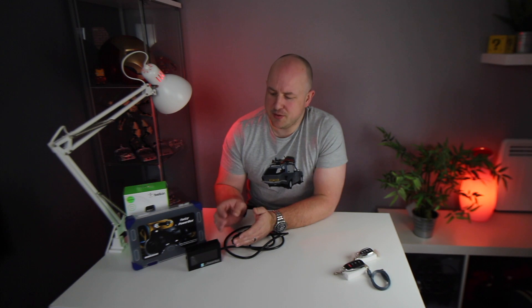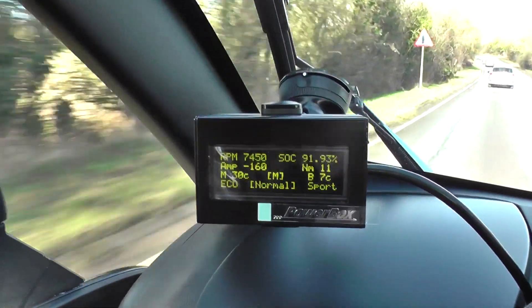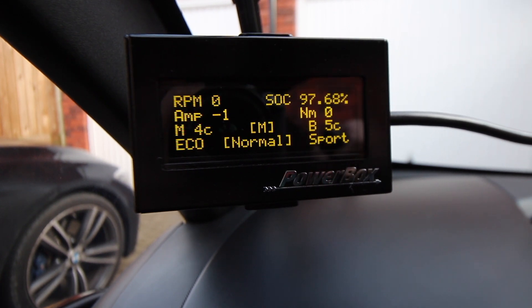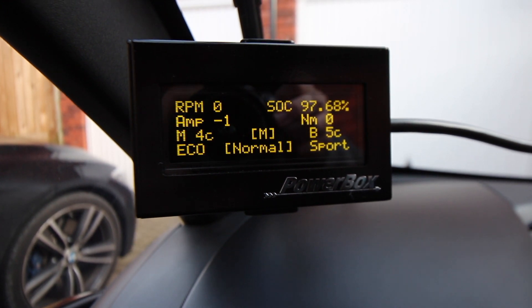On the display there's lots of interesting information. There's also a battery charging mode which is currently in beta. You can see statistics, and if you're charging off solar and want to restrict how much power you put into the battery, you can set limits on how much of the battery you fully recharge. When you're driving along it's really interesting to see exactly how many amps you're using, what Newton meters of torque you're getting out of the vehicle, and when you're doing regenerative braking, how much amperage is going back into the battery. On the display you can also see the current RPM of the motor, the motor temperature, and the battery temperature.